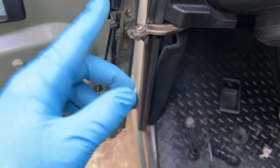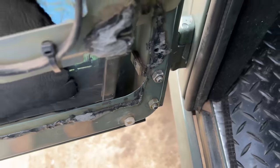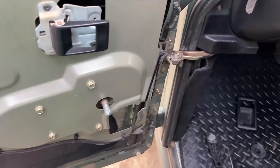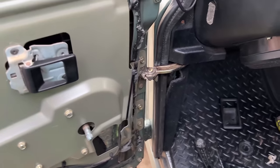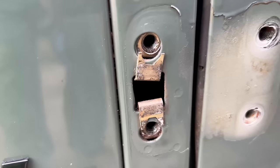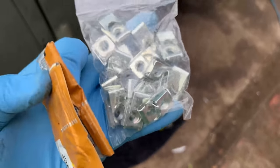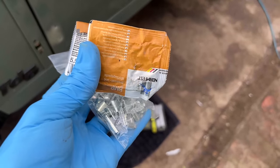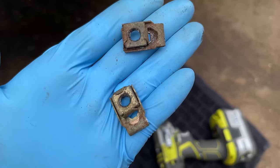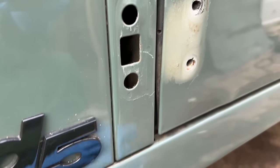I've got the door card off to do the hinges. You can do it without taking it off — I've done it before — but you just get to the nuts so much easier this way. You don't lose them or drop them anywhere. I prefer taking it off; it makes it a much easier job. One hinge at a time — you can see I've taken the first hinge off. I've got some new spire clips because sometimes these are a bit corroded and rusted, so I'm putting new ones in. I'll put a link in the description, and also some copper grease, as the old ones look a bit knackered.